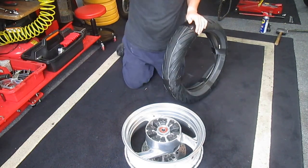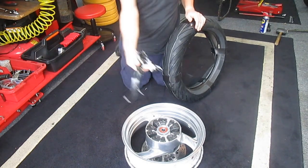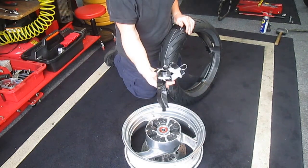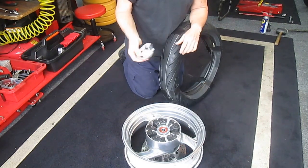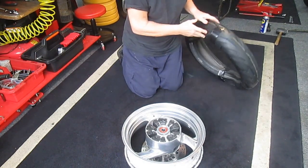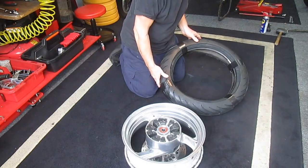Gorilla tape is the secret. Now, what I tried to do already today: when the tire is warm, you only need a half a strip — strip it in half. You can't do that when the tire is cold; it isn't strong enough. So lesson one is: do it when it's warm out. But since you want to go riding tomorrow...